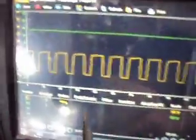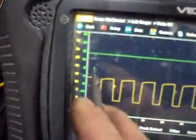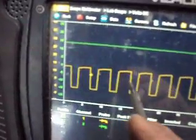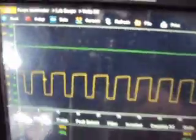Because Snap-on has never really given us a good test for these cooling fans, back-probing that control wire to the cooling fan module is about the best you can do, and then check to see that the cooling fan module is actually being turned on and off. We're on a 50-millisecond time sweep, and I got both voltage scales set at 50 volts so that we can trace both the supply to the cooling fan and the control wire at the same time on the same screen without them running into each other.